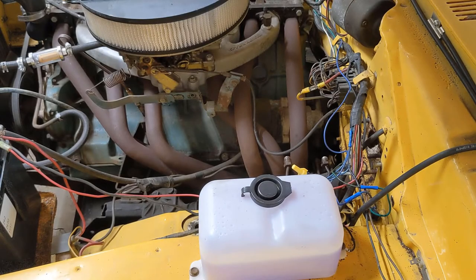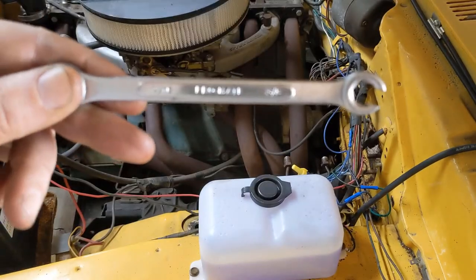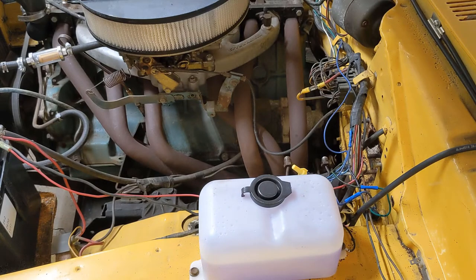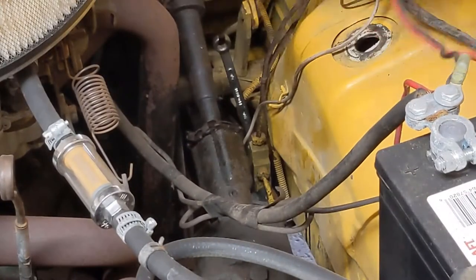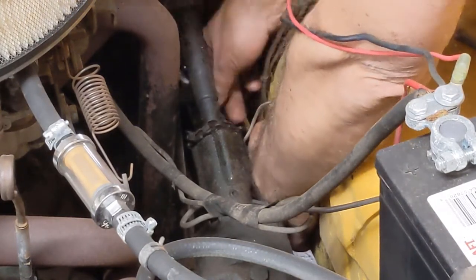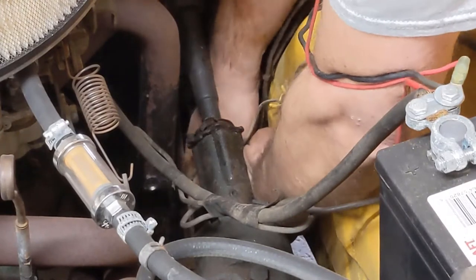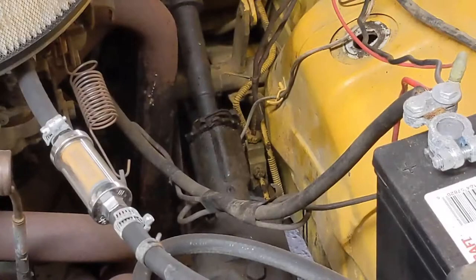With the steering column and everything down there, there's just no way to get in on there with pliers, so we're going to have to go with the line wrench. And I can almost guarantee that means I'm going to be making new brake lines. Sure enough, we now have a rounded flare nut on the driver's side, so it looks like I'm going to be making new front brake lines for both sides.